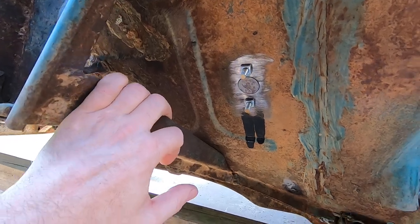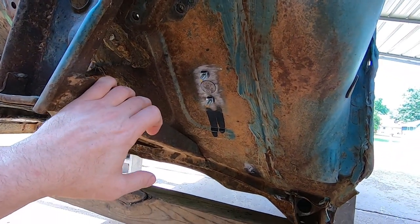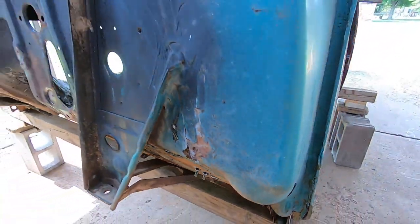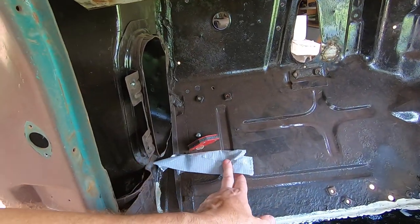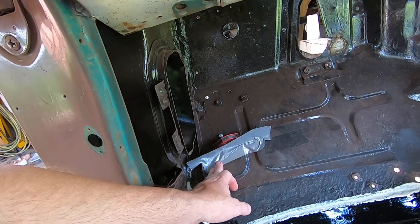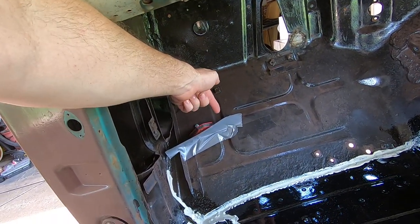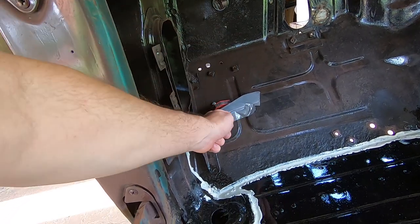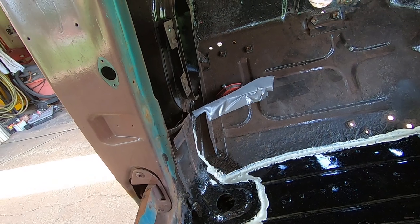But I'm out. I went down to the parts store this morning and they didn't have any in stock, so I just came back home and I'm going to weld it up. I've got a magnet holding it in there, and I've put a couple pieces of duct tape here to catch any little things that might try to pop through from welding spatter so it won't come down on my fresh POR15 and mess it up.